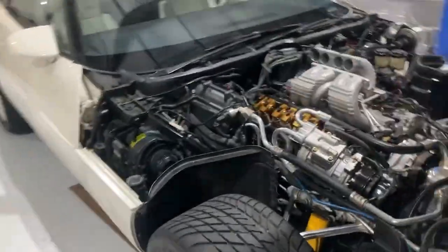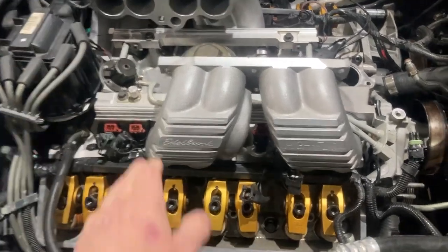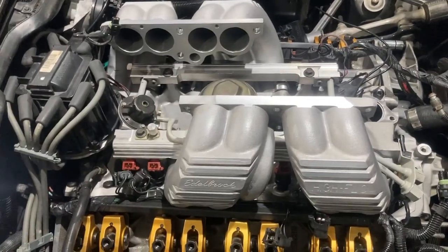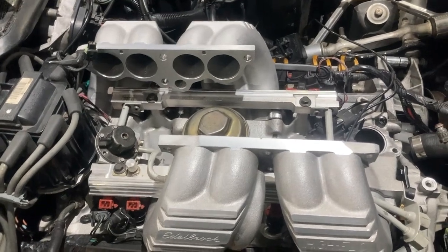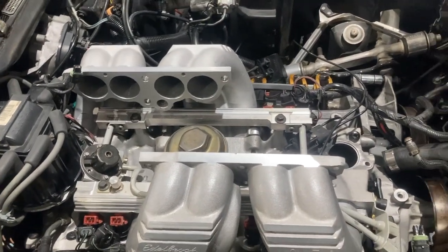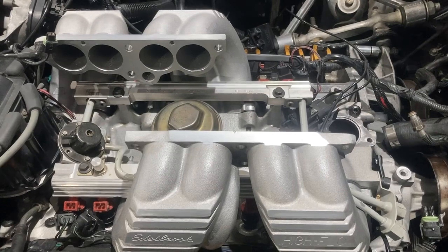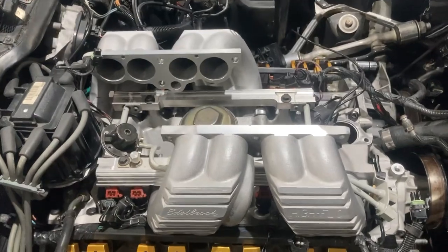Back to the tune port — you're looking at these runners on this motor, which is a 5.7-liter. I could have built it up to a 383 or something, but even with big runners, you start to limit your RPM bandwidth. If you cut your RPM bandwidth down because of the cubic inches — if you went to a 400 — it'd probably be back to 4,500. But on this particular motor with a 350, the way it's set up with light porting, you'll probably get 5,500 out of this motor, maybe 5,800. You don't want to over-cam the motor to where it's revving — a cam that pulls to 6,500 RPMs is useless because the air is going to run out here.